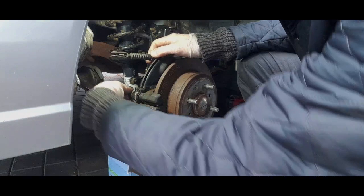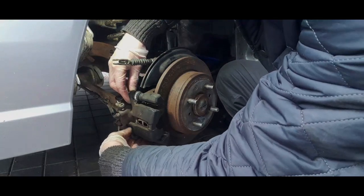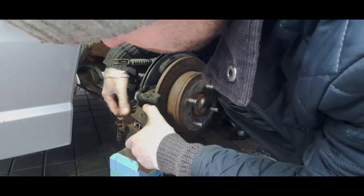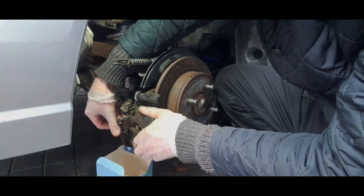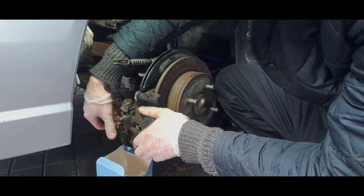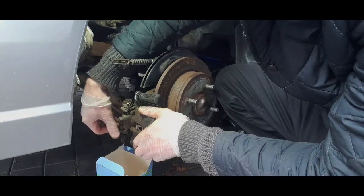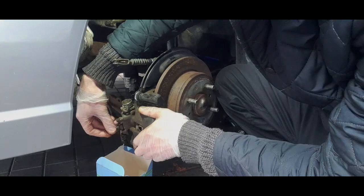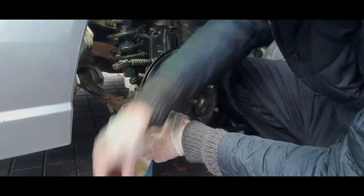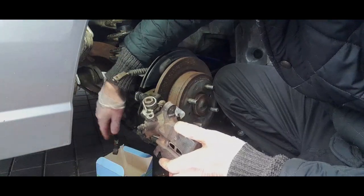We're going to lift these out, get the caliper off, and get the hardware off. I'm just going to take these two slider bolts completely out. I love the fact that these are banjo bolts and you don't have to get a spanner across like on Fords. I know I keep comparing Ford and Rover but these are two mainstream car companies of the time - Rover a bit more upmarket but not that much. There we go, out it comes - just a banjo connection.